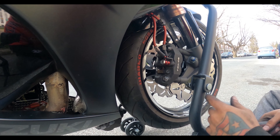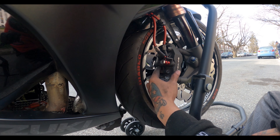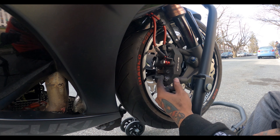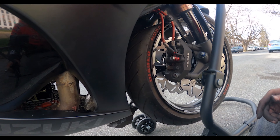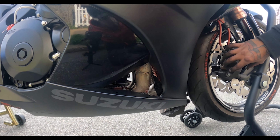That one's done. You should lubricate those pins — the ones that hold the brake pads in place — so they don't rust and they're easier to remove. I already did that previously so they still have lubrication on them.